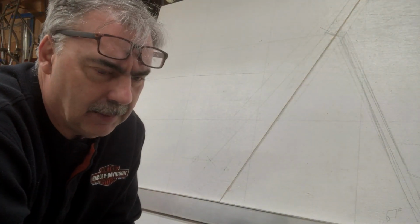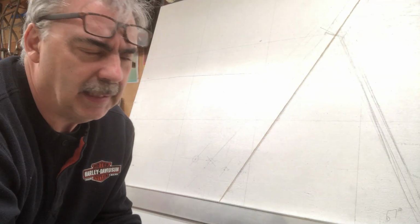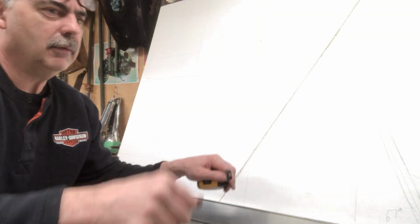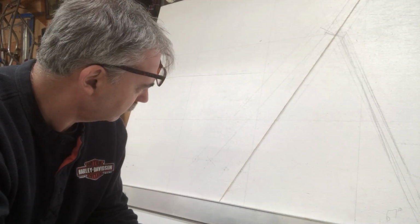Okay, so the Harley Breakout and the Softails, or I think it's the V-Rods, they're 34 degrees. That's about as far as you want to go. You go 35, 36, or 34 degree rake. You don't want to go any farther than that. And even my son's 2017 Breakout handles real nice on the highway. A longer rake is easier to handle on the highway, but in town, going around corners, it's a little bit more difficult turning the thing around as well.